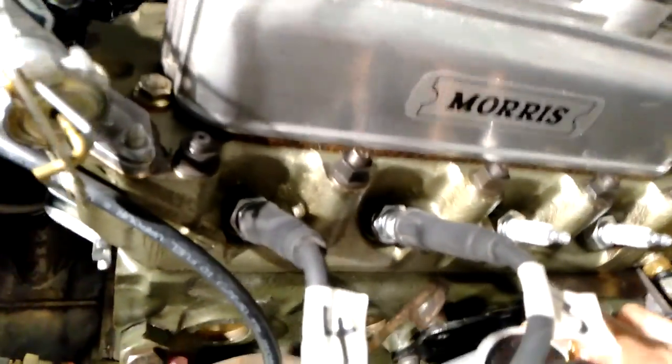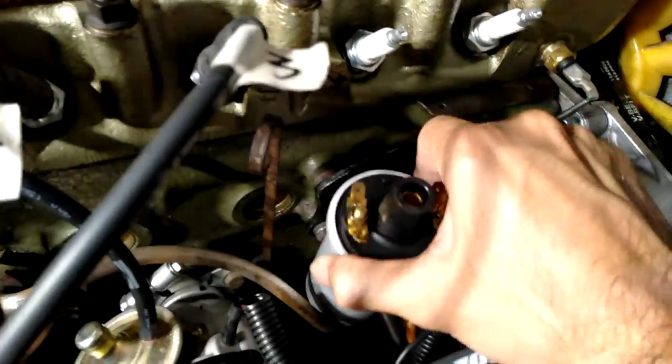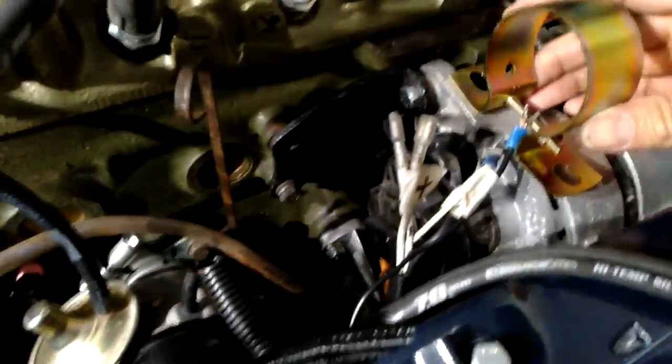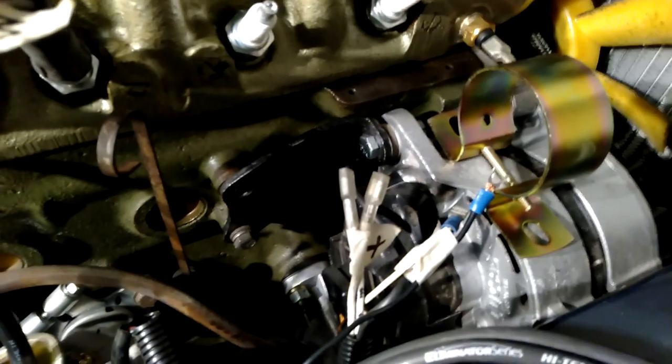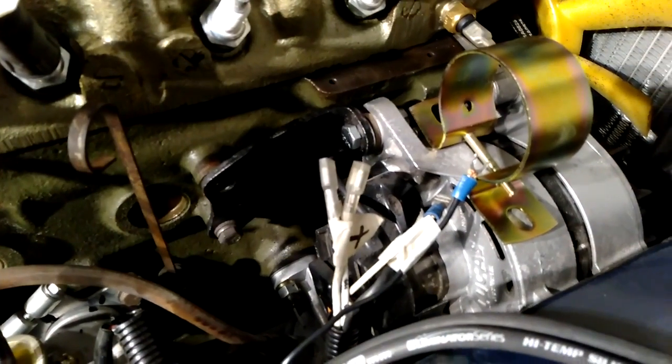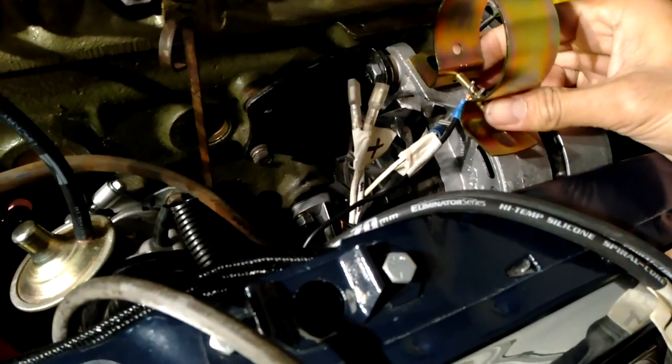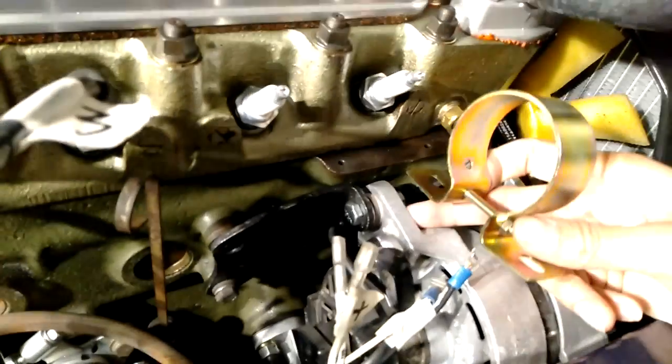I've got the oil feed in the way. The coil sort of fits in there, but I'd still have to mess around with brackets no matter which way I do it. What I was thinking is making a similar bracket to bolt onto here, so the bracket for the coil can sit there somehow. Putting it up here seems like it keeps it out of the way - it just depends on how I make that bracket. I'll see what else I can find on the internet.